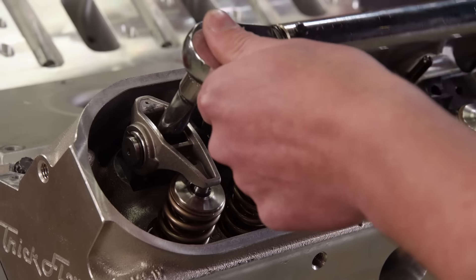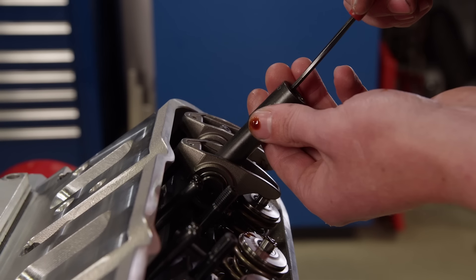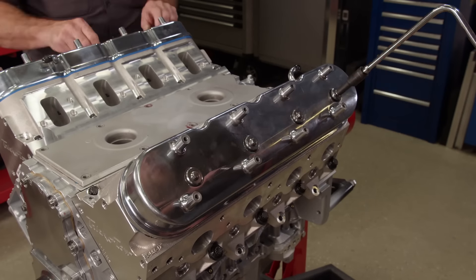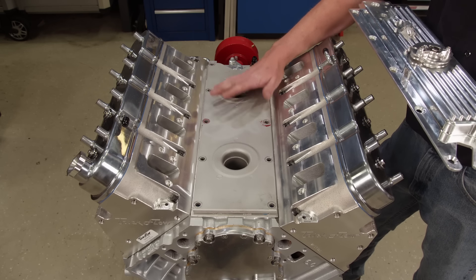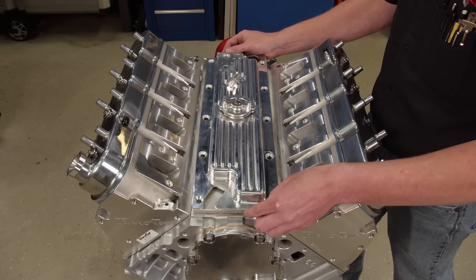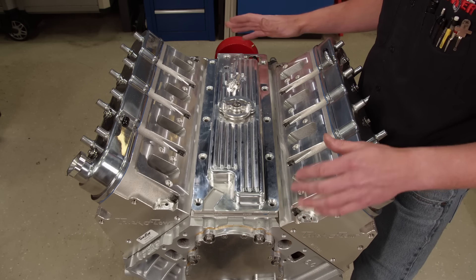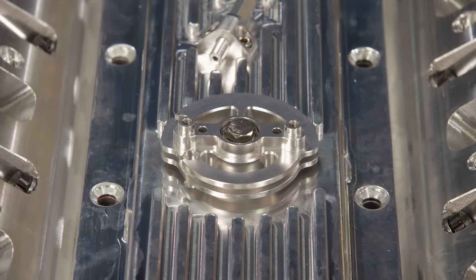The Trick Flow 7.700-inch long push rods are treated with extreme pressure lube and slid into place. The Trick Flow rocker stand, included and specific to the Gen-X 255 cylinder head, is installed. The ARP rocker studs receive sealer because they thread into the intake ports. The Summit Racing rocker arms come with upgraded trunnions for more travel and durability, installed in the firing order and torqued to 25 pound-feet. A healthy coating of Comp Cams valve train assembly spray comes next, followed by a set of polished Summit Racing valve covers. We've actually plugged the rear cam sensor hole — we're converting this engine to a front cam sensor using an ICT Billet cam sensor plug from Summit Racing, because it won't clear the valley cover that came with the Speedmaster ITB kit.